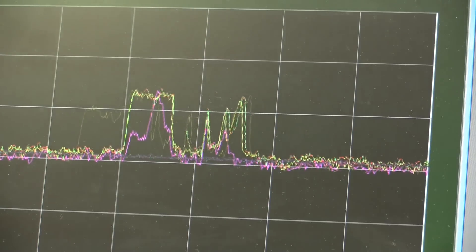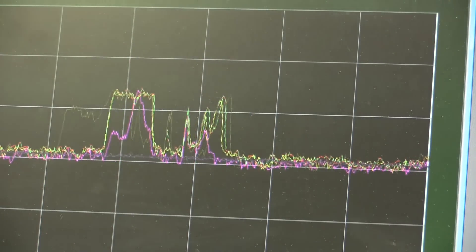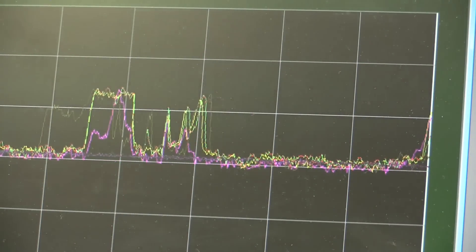Tyre temperature is a big deal because if your tyre doesn't work you don't get the performance — starting from the grip. When you're turning, if you don't have any grip you're losing time. When you know what your tyre is doing, you know your setup will be right, your suspension will be properly set up, you'll have the proper tyre pressure, and that will directly affect your tyre temperature. So if you're measuring your tyre temperature, you'll know your chassis is well set up — and therefore faster.